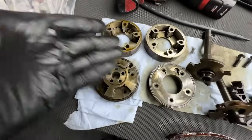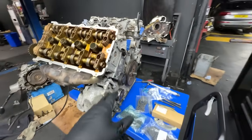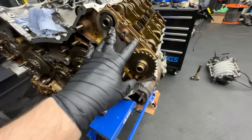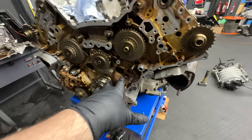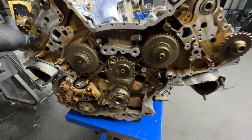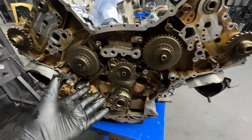One of the plastic washers had a broken one which is already gone — it's just a piece of plastic. The other one disappeared somewhere into the oil system. As you've seen on the footage when we stripped the engine down, the camshaft adjuster units were removed. You can see the strainer actually has a hole in it because of all the debris. We already cleaned up the sump where you've seen the pickup pipe for the oil pump, so that is done.